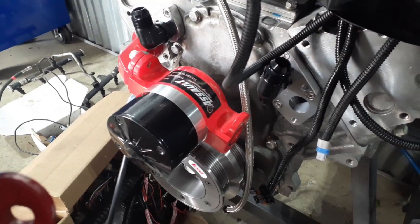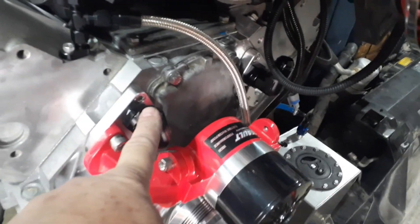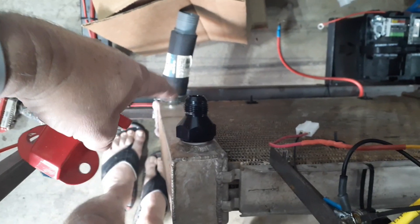So real quick, from what I figured out: the bottom outlet goes to your bottom radiator — that makes sense. These two upper outlets have to be interconnected in a Y and then sent to the upper radiator. I've got an AN-style fitting on my radiator, so here's how the fittings break down.